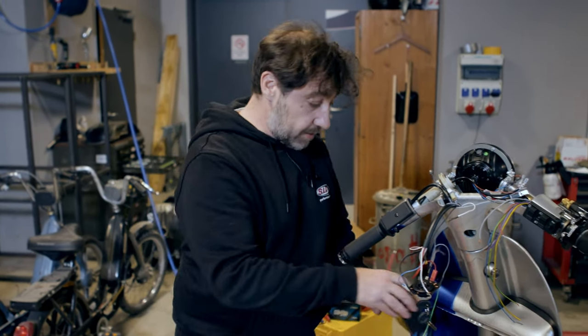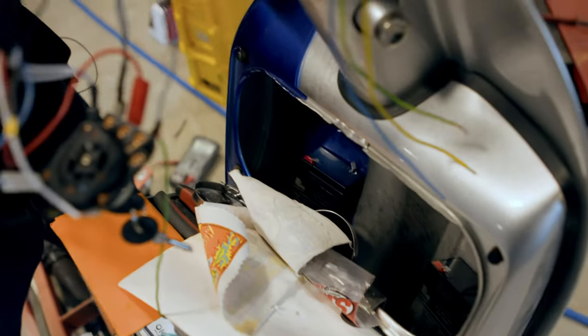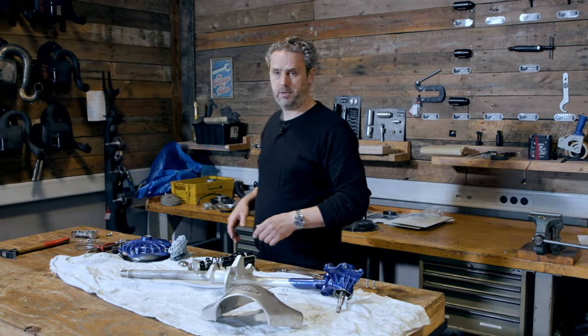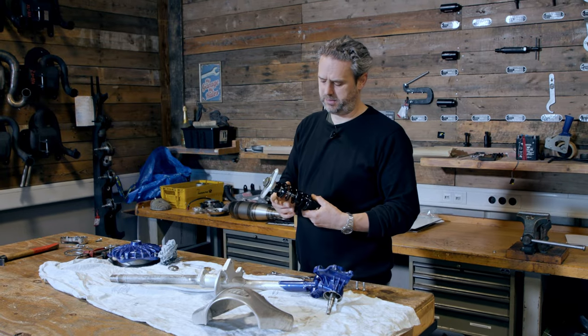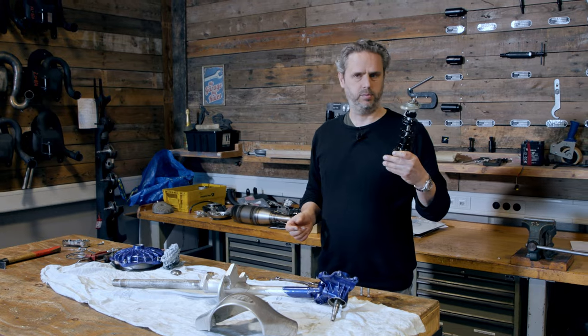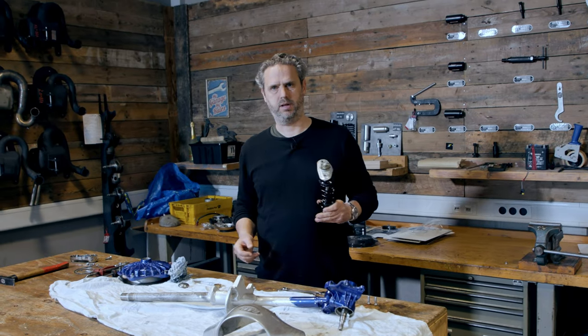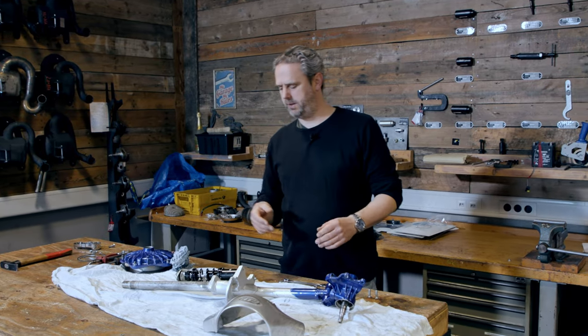I will now try to install the batteries. For this, we simply take 2 6-volt batteries and connect them in line to get 12 volts. Now everything must be reassembled, of course. First, I'll install our new SIP shock absorber. It's well suited for the PK version because of the shortened fork and the PK shock absorber. That way, we can bring it a little lower at the front.